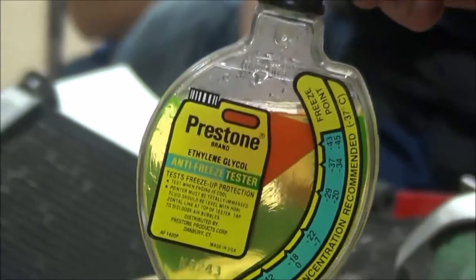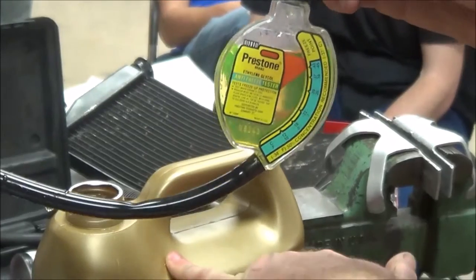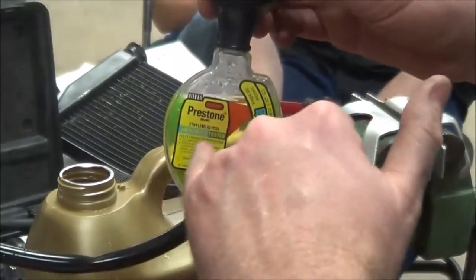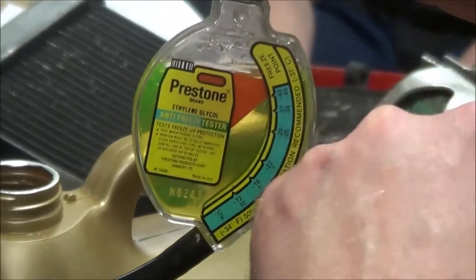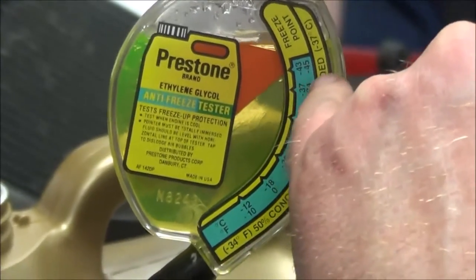The cost of it — when I did my truck this weekend it was 3.1 gallons at $12.99 a gallon. So you've got this extreme freeze point with straight coolant, but by diluting this down, our goal is to get to minus 34 degrees.